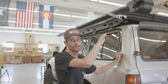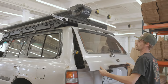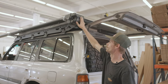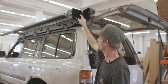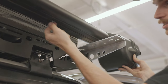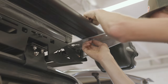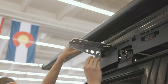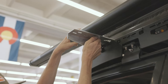At this step you can pretty much just set the fly rod holder up there. What I like to recommend, especially with vehicles where the hatch opens vertically, is to open your hatch and double-check clearances. As you can see, we're going to want to push this guy as far forward as we can. If you really want to be dialed in, make sure that with the hatch open you can still open your door enough to get your fly rods out. Pretty much right about here is going to be perfect for us. Now we can get our studs lined up in the slots we want, throw the hardware on, and we're good to go. These slide back and forth, so we just line it up with the hole we want, drop it right in, and put the hardware on. On the other side, make sure you're going in that same slot at the same position so that this is nice and in line with your rack — drop it through, put your hardware on, and snug these down with your wrench.